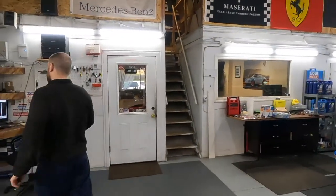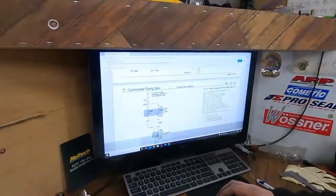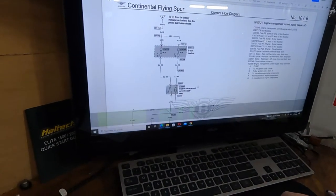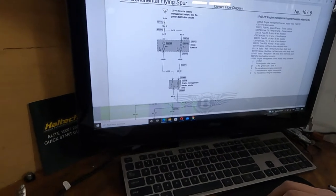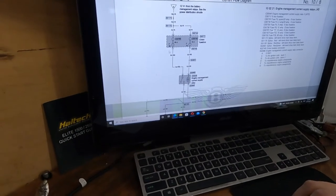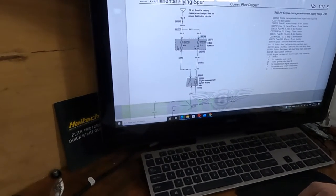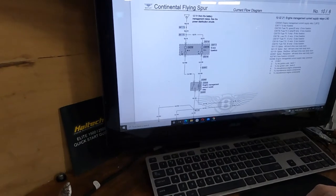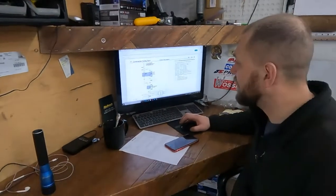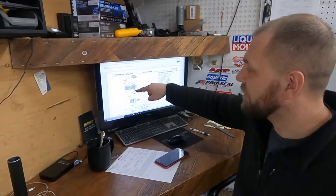Follow me, let me show you. Here is the diagram, and this is the e-fuse box, and this is the engine management current supply. This is the supply relay 2 and relay 1. Here is the energizer. This is the ground from the ECU, and here is fuse F15. Actually, this fuse is not present on this type of Flying Spur, but this is the permanent 12 volt power, and it goes to this relay.